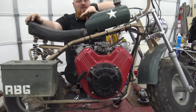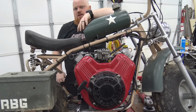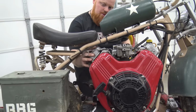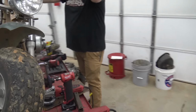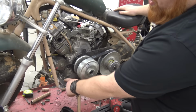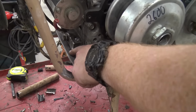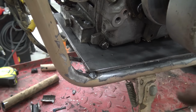The V-twin is on there. We just put stationary holes, so the engine does not move forward or back, which it couldn't anyways very much. You got like an inch and a quarter inch. Yeah, we don't have much room. So we got those holes drilled, and how we did that was we marked the center of this hole on the plate, then I outlined the block, and then I did some measuring, got all the holes drilled. And they all fit. First try.